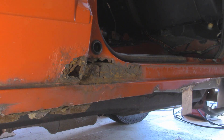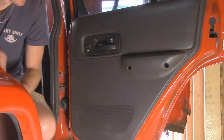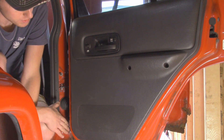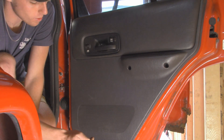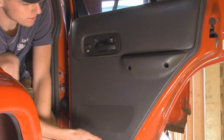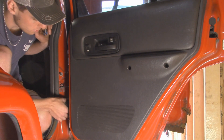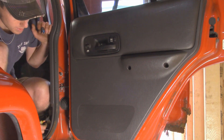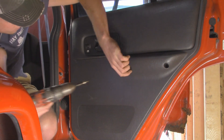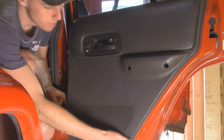What I might end up doing is actually taking off the door panel, and you can fit a blowtorch through there and kind of heat up that plate that's threaded where the bolts go into, and usually they break free by then. So for a quick overview on getting these doors off: we basically have the hinge bolts over here which are going to be a T40. The top ones broke free but the bottom ones did not. So I'm going to take off this panel — there are just some Phillips screws and it's basically clipped in the rest of the way. Now we've got a couple of rod linkages over here for the handle and the lock, and then we also have a door check that we've got to pound out the pin, and then take this boot off here with our electrical connector. And if you have the trim off on the inside, you've got the electrical connector right here that you can just unplug from the rest of the harness.